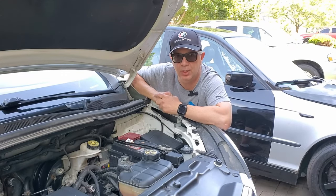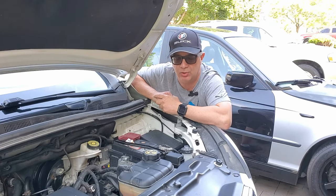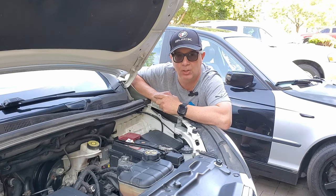So today what I'm doing on this Buick Encore is an automatic transmission fluid flush, but it's not the first time — let me explain. Typically I would have done a complete transmission flush, but I ran into issues with this vehicle. The connector to the transmission cooler is seized in place, so I can't drain the fluid from the cooler at the same time. This is the third time I'm doing it — I'm draining transmission fluid in percentages of the total eight and a half liters capacity.